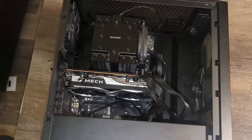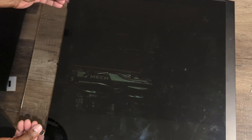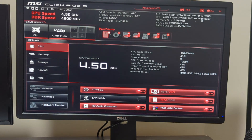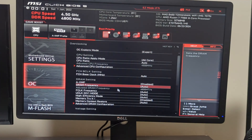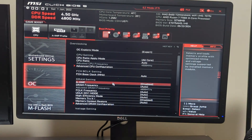Now let's go ahead and put back in the graphics card. Graphics card is back in the PC. Let's put back the panel, secure it, get all the power cables and display cables hooked back up, and let's go back into the BIOS. As you can see, we got the reset and we are back in the BIOS. Going over to Advanced to check the overclock settings — XMP is disabled and the DRAM frequency is reset, but most importantly you are back in the BIOS without any issues.